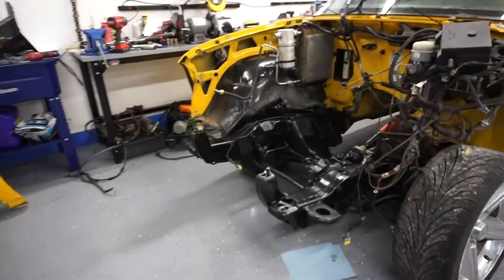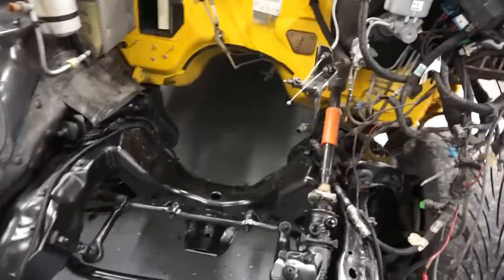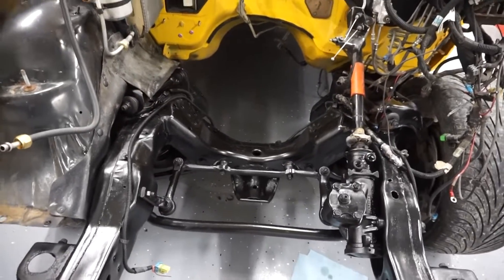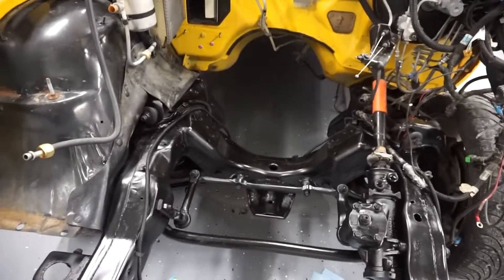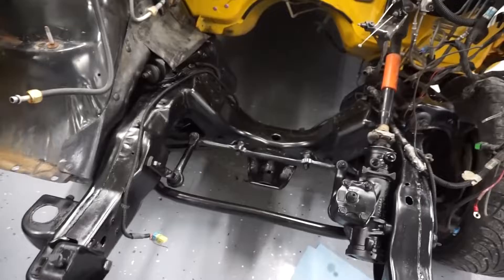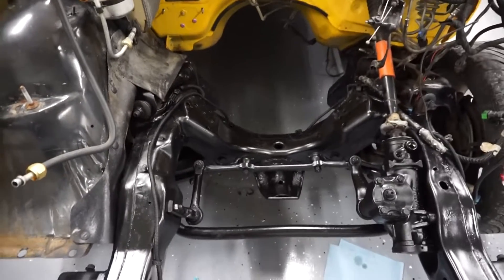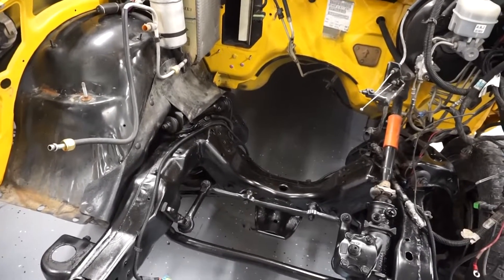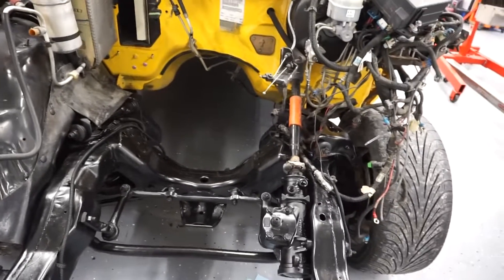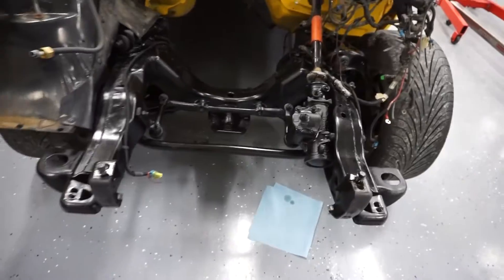So here's where we're at. I did pull the truck outside, pressure washed the whole bay down there, got rid of the old engine mounts. That thing was absolutely caked with old grease and mud and crud. We power washed everything with some degreaser, scrubbed it with a stiff brush and then a wire brush, and got it all down to either the original coating or bare metal. From there, I threw on some self-etching primer, followed up with some rust reformer, and then some engine enamel with ceramic. Put a few coats of each of those on and it came out looking pretty good.